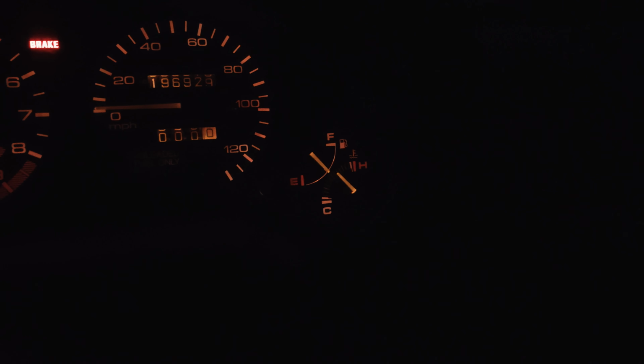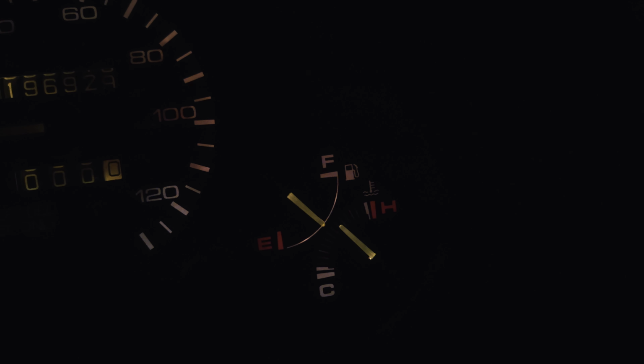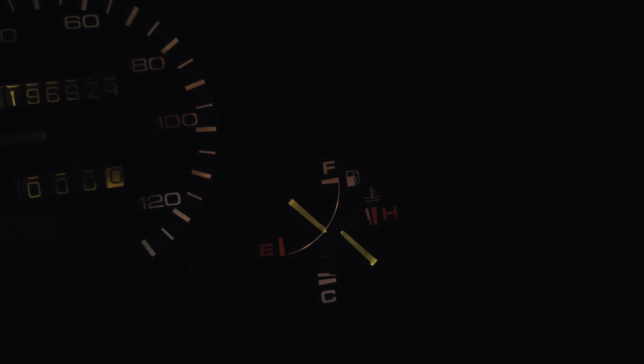Yeah, so had to pull over. Started super overheating. I'm just in some neighborhood right now, but you can kind of watch this go down while I'm on it. And my reservoir, my overflow is steaming. I don't think my fan is turning on. And I got a check engine light while I was on the freeway, so